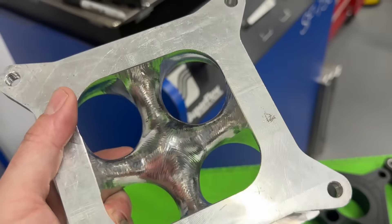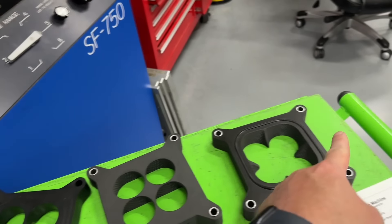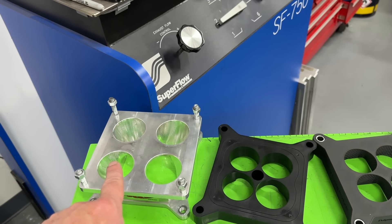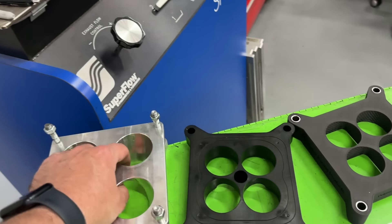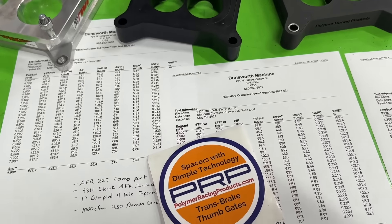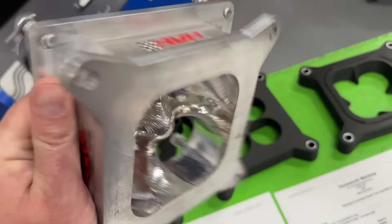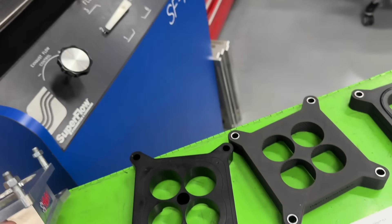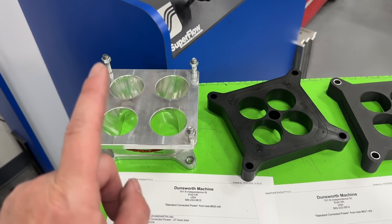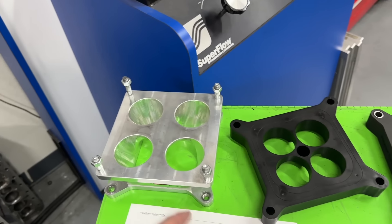This is an HVH with a 4150 bottom and a 4500 top — made for 4150 manifolds with a dominator carburetor. It tapers down and is the only spacer I've ever tested where putting it on with a dominator gains 15 solid horsepower everywhere and about 20 foot-pounds of torque consistently. I've been trying to get Polymer Racing Products to make a tapered four-hole dominator-down-to-4150 version with dimples, because that may be the ticket. Right now this HVH is the only one that guarantees big power gains.